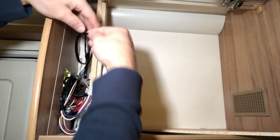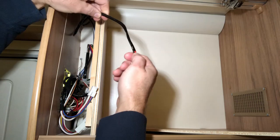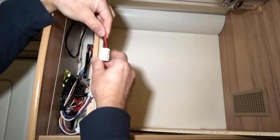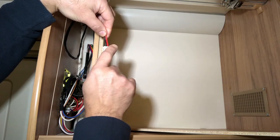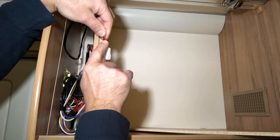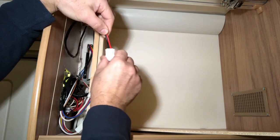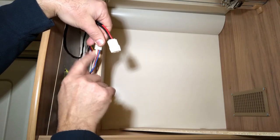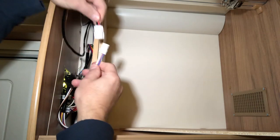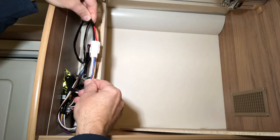What I've done is purchase the correct amperage of wiring and taped them together with loom tape to create my own wiring loom. I purchased the plug kit, and with the kit comes crimp-on terminals. I crimped the terminals onto the end of the wires and slotted the wires into the plastic plug — making sure the black lines up with the white, because the white is the ground or the earth. Plug them together, and that looks factory fitted.